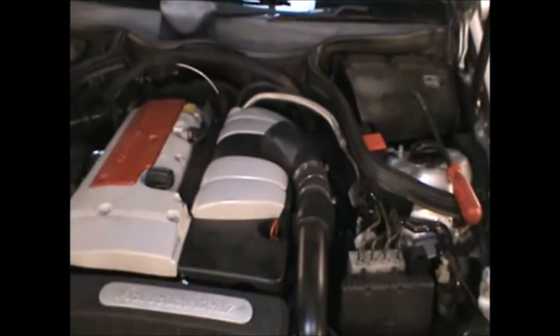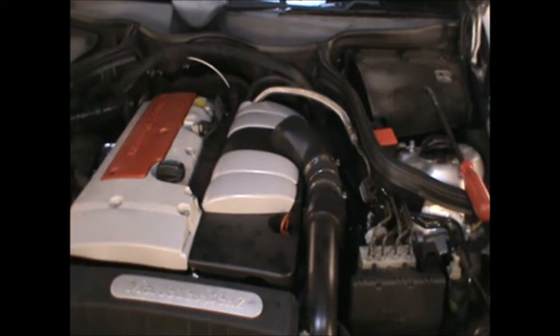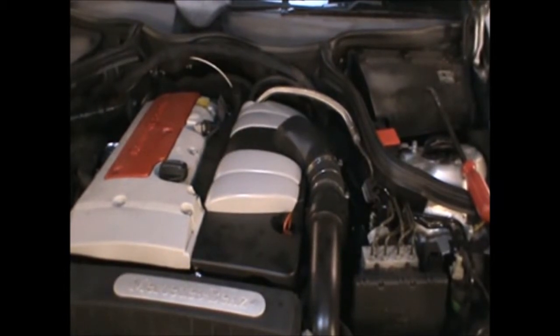And the reason for that is that the engine revolutions drop a little bit occasionally, as if the car wants to cut out, but it doesn't actually cut out, and it's very, very rare that this happens. But it is a common symptom of a dirty throttle body flap. So I'm just gonna clean it, hoping it will make it better.